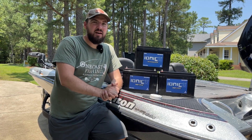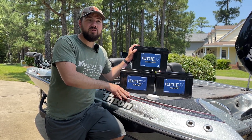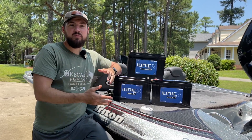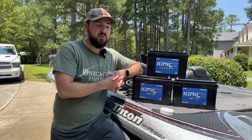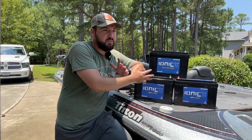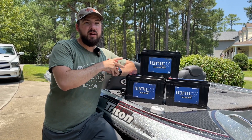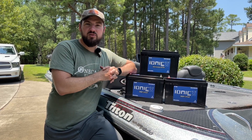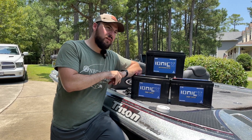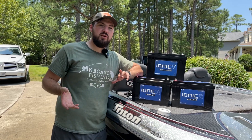One additional benefit I have to mention is the lifecycle of these batteries. You can discharge and recharge lithium batteries 2,000 to 5,000 times; traditional batteries are looking at 300 to 500 cycles. They're going to last a whole lot longer — that's why this battery has an eight-year warranty. Some other manufacturers offer five-year warranties; I even saw one with a twelve-year warranty. So even though they're cost-prohibitive, in the long run they can actually save you money. The main reason I had to switch was my power consumption — especially with the LiveScope, which is known as a battery killer. Those are the reasons I switched to lithium. I'll do an update video in a few months. Thanks for watching — like and subscribe, and remember, a lunker's one cast away!